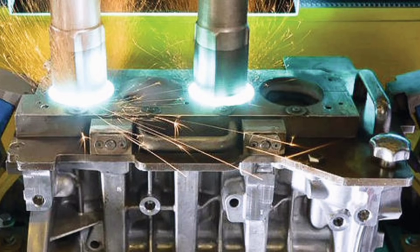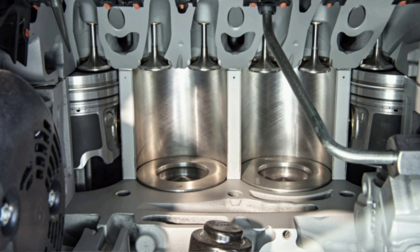Good fuel and good cooling are key — everything that affects cylinder pressure and temperature inside the engine is going to be transmitted to that piston, so if you want it to live a long life, you need to make sure you're taking advantage of those things. The engine also goes through some treatment processes, primarily done for efficiency and reliability. BMW has emissions targets to reach, but more efficiency from an engine also means more power with less work — so it's a win-win. The first treatment inside the cylinder is called electric arc wire spraying, or LDS. They melt down a metal and spray it inside the cylinder walls, which reduces friction and increases reliability by reducing wear. This also helps with heat transfer, which is important for keeping those cast pistons from getting too hot.